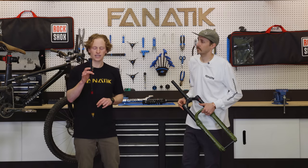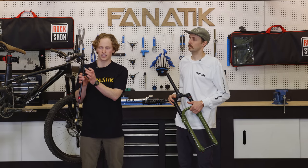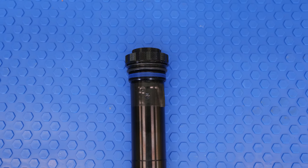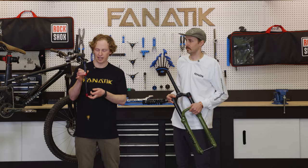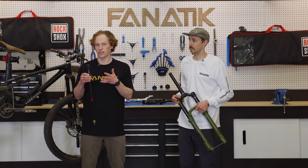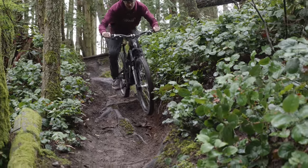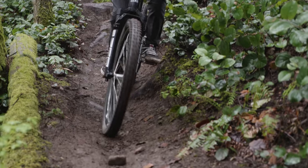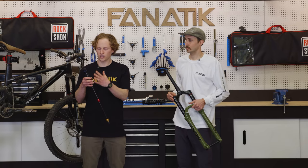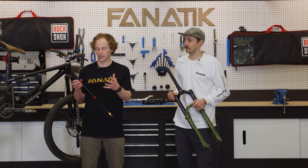This is not a bad thing — this design has a number of advantages. First, it can actually self-bleed: there's a little bleed port where if there's too much oil in the damper, it can purge out. Oil can move in from the bottom, and if too much gets in it can purge out at the top. All of that results in less friction — oil being able to get in from the bottom is a good thing for forks since we don't want friction when we're looking for a supple feel. It also means less maintenance, as it's easier to rebuild and requires fewer tools to rebuild.